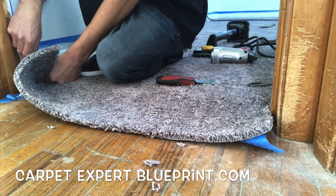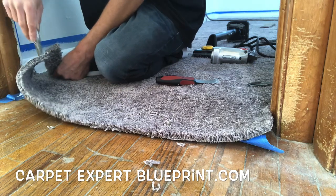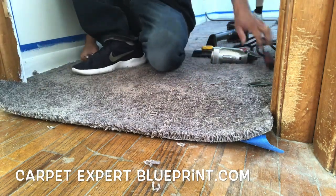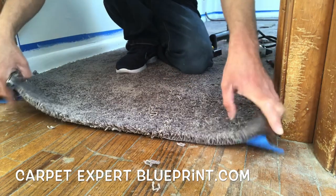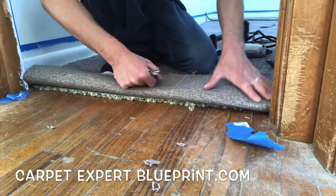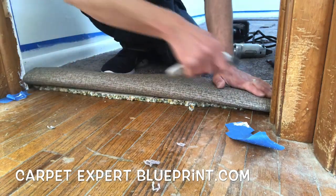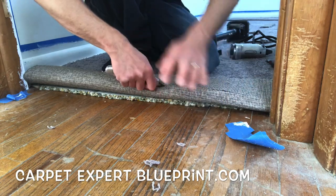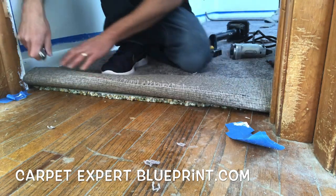Personally, I like to take my knife and trim the sides of the door jamb first so it's going to lay nice and flat. Next, we've got to go ahead and make these some manageable size pieces so when we're all ready to rock, it just falls right into place. So we're going to fold this back and cut it — it's going to be about an inch hefty of where I want the carpet to ultimately end.